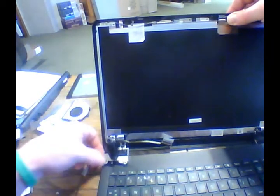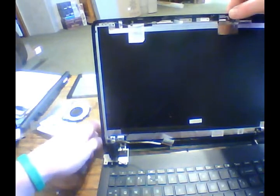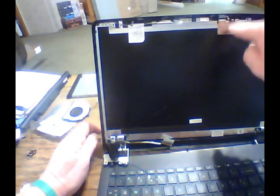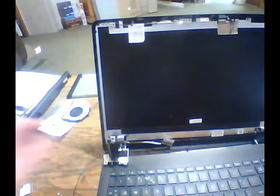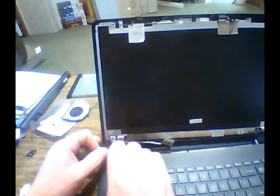You don't want it real tight. Just pull just that slack out of there, okay? So that'll still stay in place without binding up that wire. You don't want it right down. You want a nice little loop in there so it's not pulling on that solder joint, because that is not real strong. So now that we've gotten that done, we're going to go ahead and tighten down those three screws, and that will hold all those wires in place.